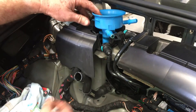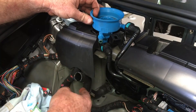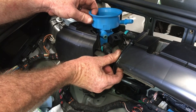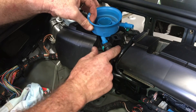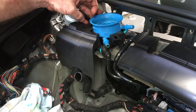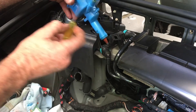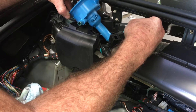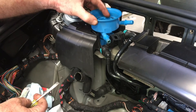The filler port has one of these clamps on it that you just need to loosen and take off, then wiggle it free. To remove it from the housing with the hoses connected, the one underneath will need to be pulled up and out before you can get at it, but the other one you can just squeeze and pull off. The filler port itself has two tabs — one on each side — which just clip onto little barbs. Get a screwdriver in and push rearwards on each side, then pull it up and it'll just pop straight off.